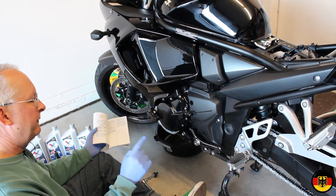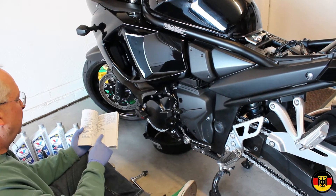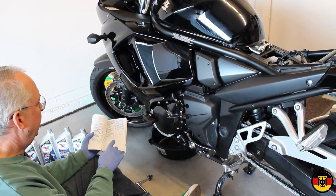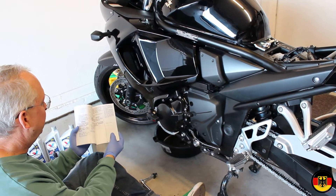Hello, I'm Guru Scott. Today we're going to do my first oil change on my Suzuki GSX 1250FA. In the manual it doesn't give you the drain plug torque. We looked it up on the internet and the best advice we could find is 23Nm. That sounds pretty reasonable, so I wrote it into my book.